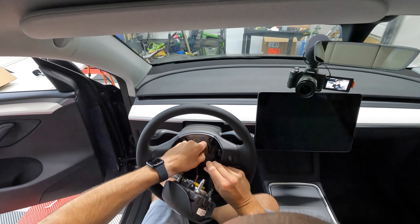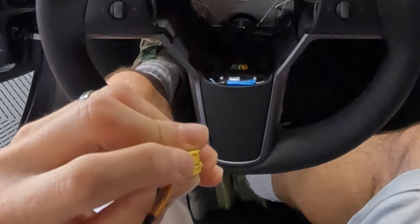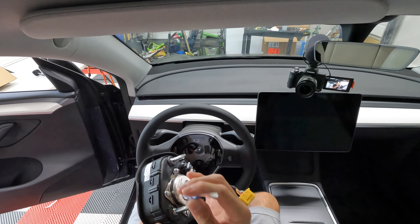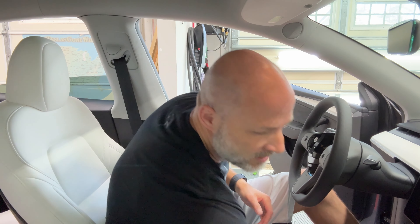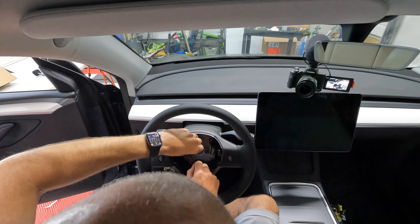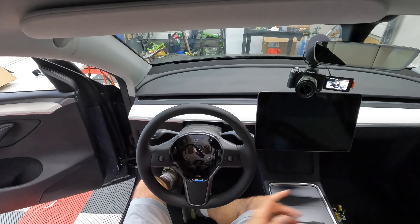The airbag should not deploy because the car is off and we're not even in drive. There we go — it's those two clips right here that get pushed in and then it comes out. If you wanted to remove the airbag cover, you just slide in underneath and pop it out on each one; you probably want a bunch of screwdrivers or some plastic to wedge in there. Now we're going to set this aside. There is another connection right here we want to remove — it's the purple one — that came out super easy.